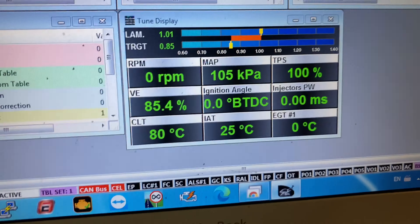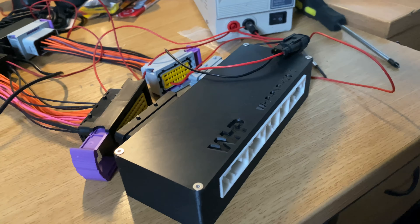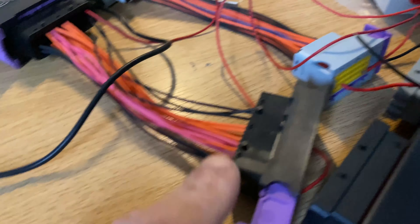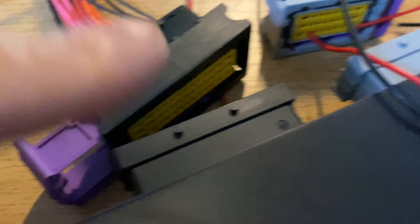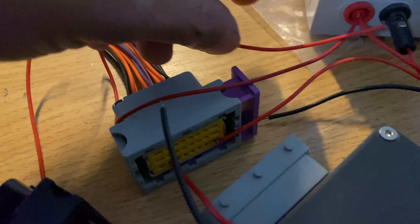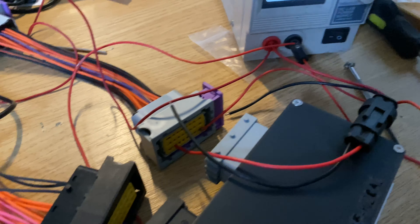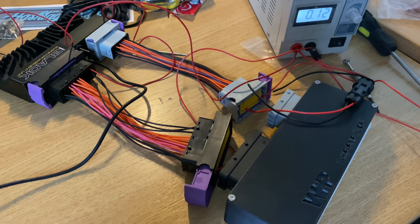The ECU is all connected as you can see. Those are just the standard values and my map — a bit of a mess. Since all those connections go to the Honda side, I had to find another way to wire it up at home. The USB cable goes to the laptop. I tapped into the other side since I don't have the Honda here. There's a ground, there's a power, and there's actually another ground I can use to make sure it has enough ground. Next I'm going to connect the CAN-L and CAN-H low and high wires and see what they do.